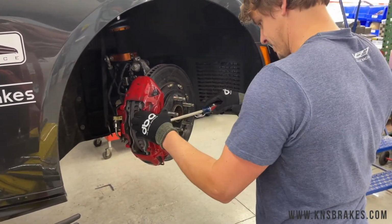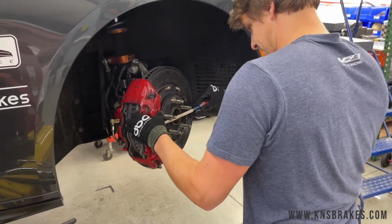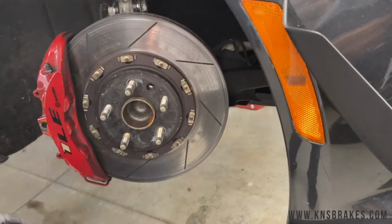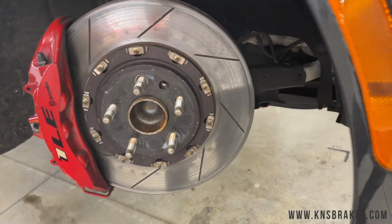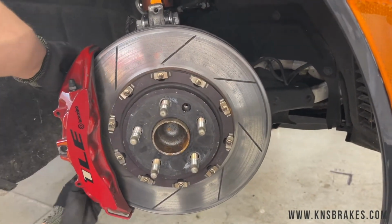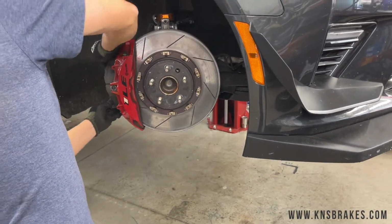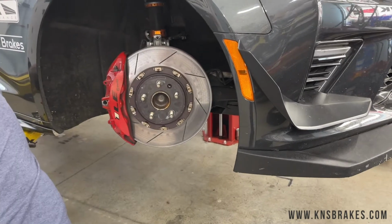And in this case, we've had the rotors off before, so the set screw that was on there rusted in and we had to drill that up. That's not uncommon. It's not necessary or needed for anything other than holding the rotor on there when you're doing the reinstall.